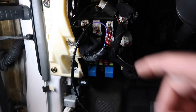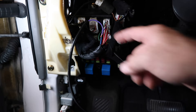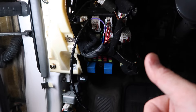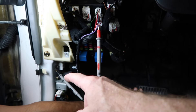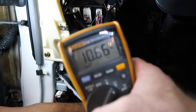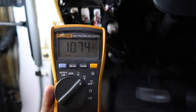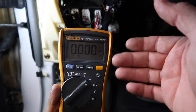Fernando found it right here. In this Santa Fe, up here in the body control module, there just happens to be a blue wire that is the reverse wire, and we're going to go ahead and solder into it. Now the question is, how do we know that's the reverse wire? For that you need either a digital multimeter or a test light. Put the positive test lead on the wire and the negative test lead on ground, then put the car in reverse — you'll see anywhere between 9 to 12 volts. Put the car back in drive or park and it goes away. Most reverse systems are positive. Whether you get it at Fernando's location or back at the light, it doesn't matter — just remember you're not using it to power the camera.